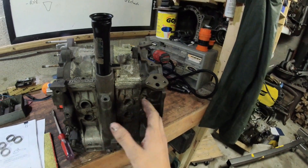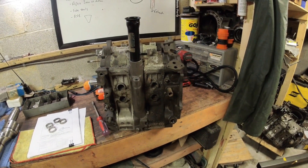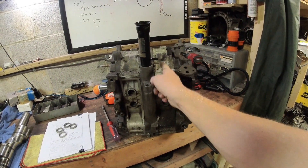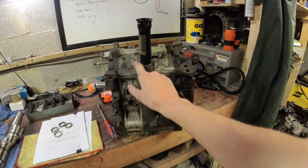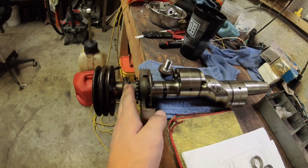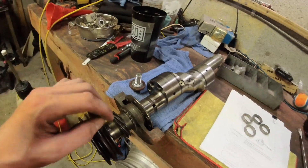If you're building engines, you should have a bunch of end play spacers on hand. Here's how end play can change when you rebuild an engine: end play is essentially the distance between here and here on your eccentric shaft, allowing it to move a little bit. When you rebuild and swap out a housing, that housing might be microscopically thicker or thinner than the one before. Both housings, the center iron — any replacement can change the end play.